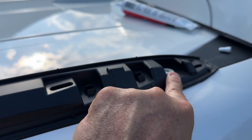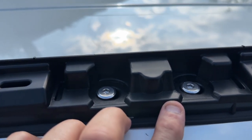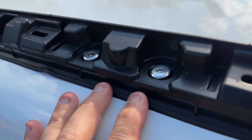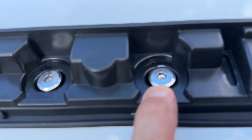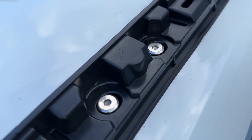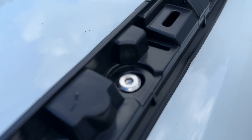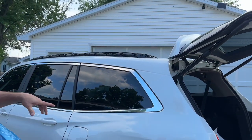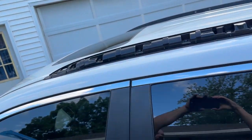With the smaller ones, I would have loved to put the washer they included, but there is no way to do that. With blue Loctite you have no problems at all, but with the washer you had like one turn. These are the exact same size as the one from Honda, but it doesn't need to be overly tight. Right here is not plastic — that is metal — so it's going to wedge down there just a little bit. Your main anchors are the three big ones on the front, middle, and end. The two smaller ones will not fit with washers. Don't over tighten them, but make sure they're down in there and use the blue Loctite.